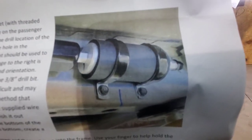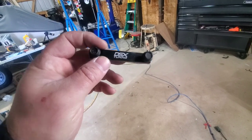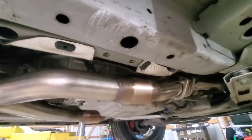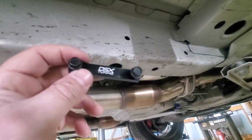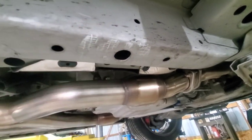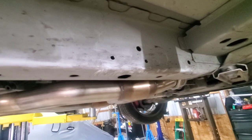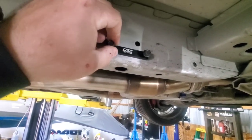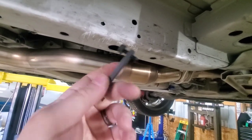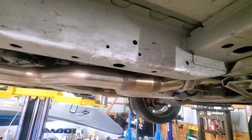In their instructions they show you to use that larger hole in the front of the frame to locate the bracket they give you — it's right there. You're supposed to hold the bracket right here; it's threaded. You're going to set it where you want it, get your holes drilled to this pattern, using it as a template. Then this goes on the inside and acts like nuts that the screws go into, to hold the two clamps that hold the pump. So here I've got the two holes drilled — just to show they both fit through there like that — and this will allow you to put the clamps on for the fuel pump.